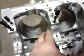Once I go into just those four points and give a little more room, we have crank end play as long as the counterweights aren't down in that area. The worst point right now is in the front — these two red points are still rubbing and brushing, though it won't lock the crank. I notice when the counterweight is down near the number two main saddle you lose the end play, so I'm going to cut a little more there and lightly here, then polish and stress relieve it.